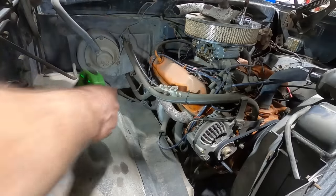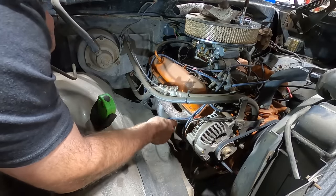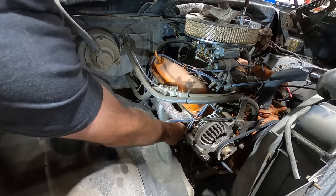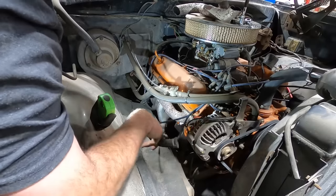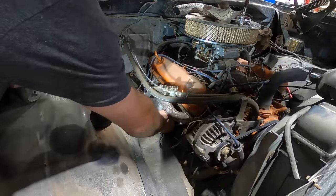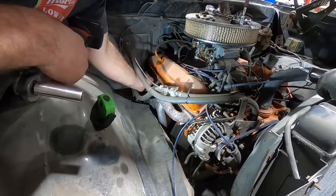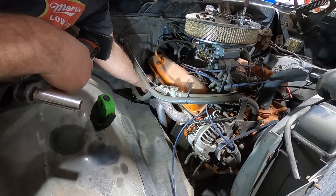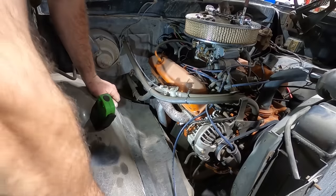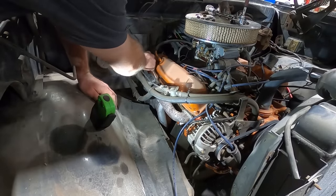Don't say that. On a positive note, the firing order looks like it's the same as a small block Chevy, 1-8-4-3-6-5-7-2, but it's counterclockwise on the distributor. And you rarely have exhaust hardware come loose when you've got manifolds, but with headers, it seems like it is a non-stop battle fighting loose hardware.